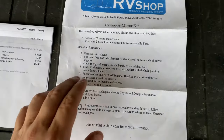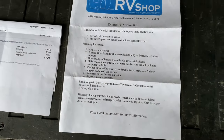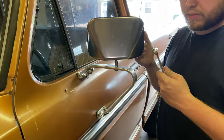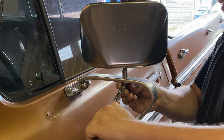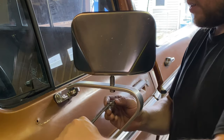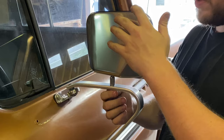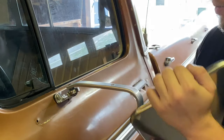This right here is a simple instruction manual that tells you step by step how to do it in case you have any questions. First step is to remove this bolt here — it's a 9/16ths. We're just going to simply take this bolt out and the whole mirror assembly should come right off. They're generally not that tight, but if yours is original they might be rusted in there.